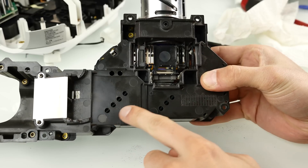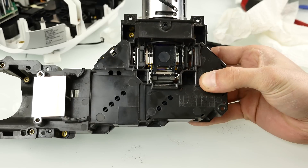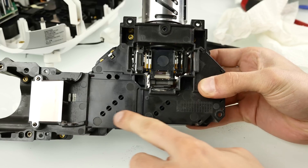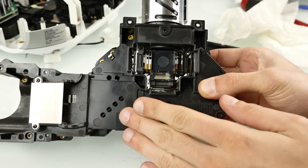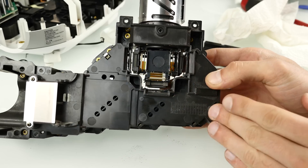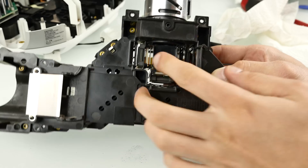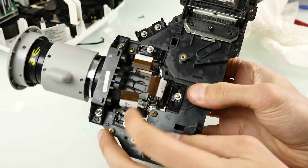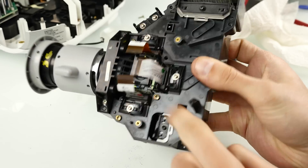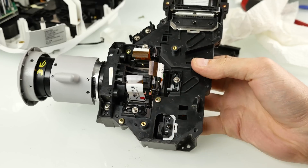We have some of those mirrors which are redirecting the light, and also some light can pass through the mirrors. That means, for instance, here we absorb or redirect only green light, then here we redirect red light, and here the blue components of the light. So it gets separated into RGB — red, green, blue. Then here we have very tiny displays. You can see the flex cables, the connectors to the motherboard — here the one for the green color, here the one for red, and here the one for blue.